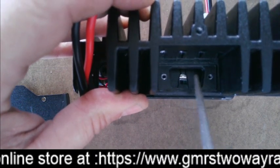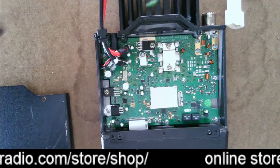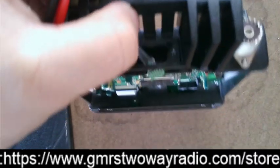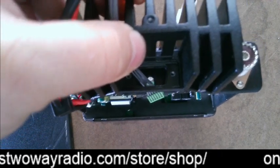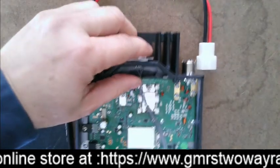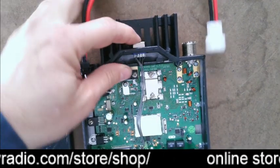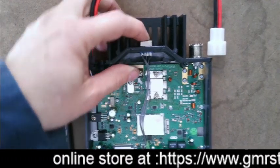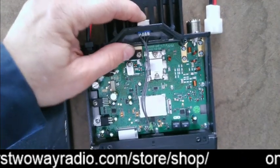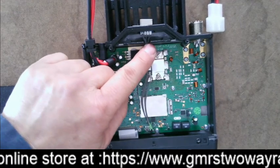This opening is where the connector is going to mount. Take the connector and fish it through — the connector can only go one way. If you look at the hole, there's a wide end and a narrow end at the bottom, so the connector can only fit in one orientation; if you try the wrong way it won't fit, so flip it around. Now is a good time to check if the holes line up before you plug the cable in. Then fish the cable through and make sure it sits in the notch so the wires don't get pinched by the cover.